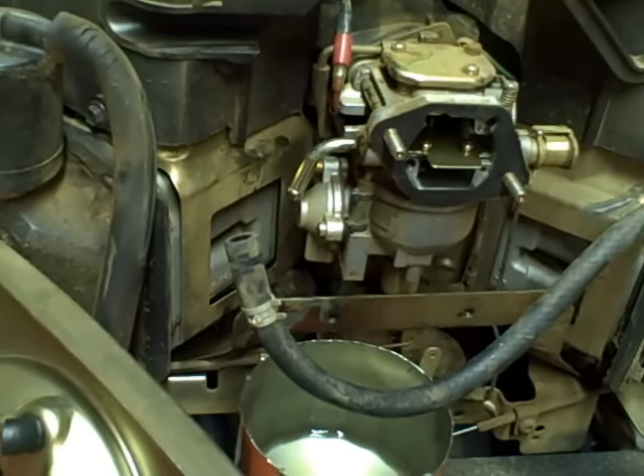This is the recommended method for checking the fuel pump according to the Kohler manual. Kohler says the pump should have a minimum flow of two gallons of gas per hour, but doesn't specify how to measure that flow. They basically say make sure there's fuel being pushed out of the pump when the engine's turning over — if that's the case, the pump is good. Anyway, I hope you found this video helpful and thank you for watching.